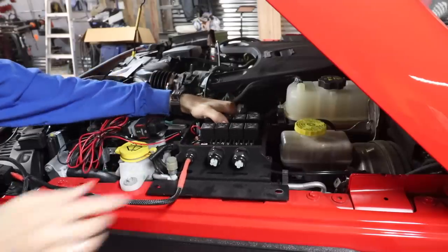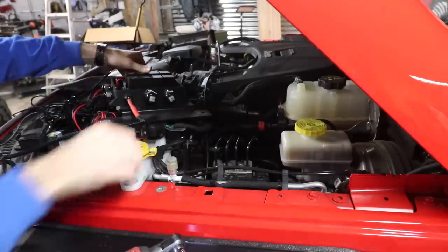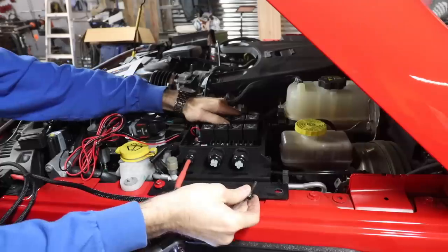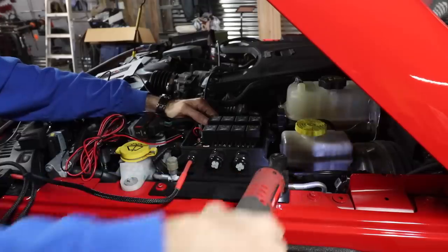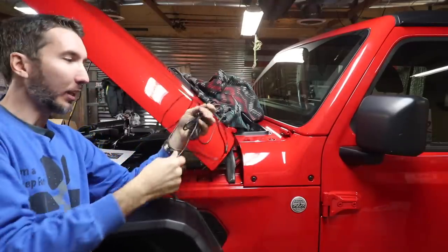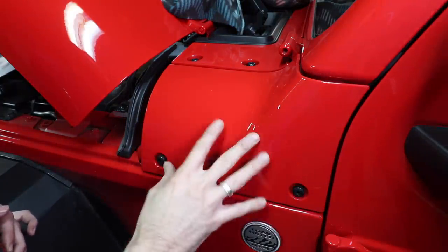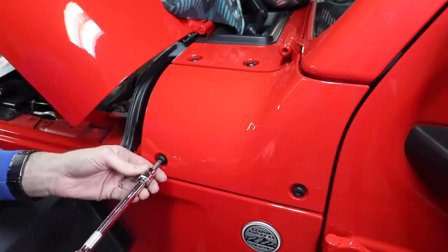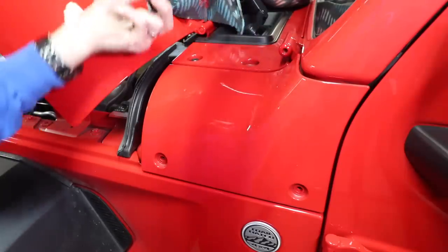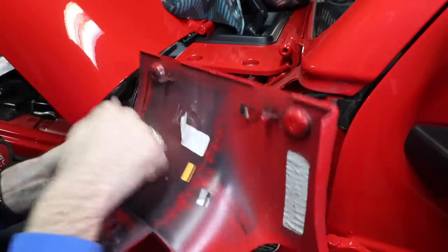Step one — this thing was made to mount right here on the driver side of the JL. So we just need to take out this one bolt right here, put this in place, bolt it down with that factory bolt, and on the other side they give you this bolt in the kit. One of the cool new features on the JL is the cowl corner — these things are removable on the JL, which before they would always get dented and there was no way to replace them. That's kind of cool. This is a T40 Torx, by the way — and that thing's made out of plastic.